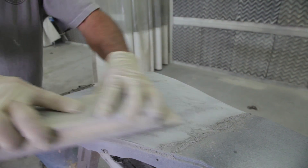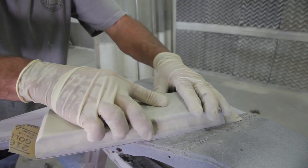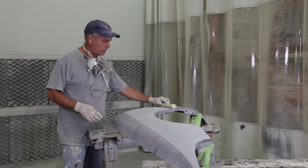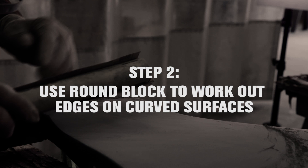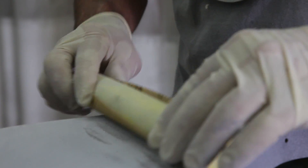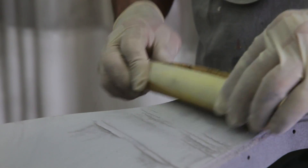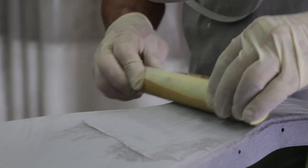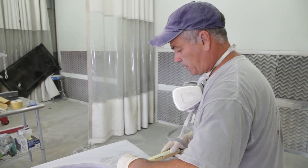You can see where I've been sanding with the straight block and I left some edges in there, so you need to use a round block of some sort and work that area out. I'll just use some Stick-It on my round block. When I'm doing this I'm always rolling my wrists — if you went straight you would leave an edge just like with a straight block, so you always want to be rolling it.